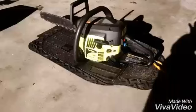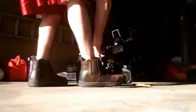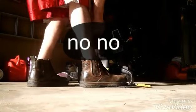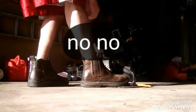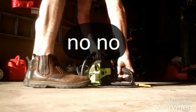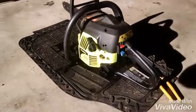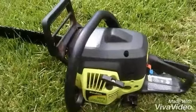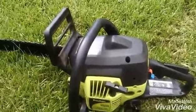And here's the saw itself. So what I want to do next is try to see if I can start it myself. I was able to start the chainsaw following the startup instructions. I started it and let it run for about five minutes, and he was right — every time it went to idle, it would start to bog out.